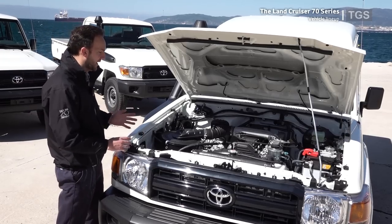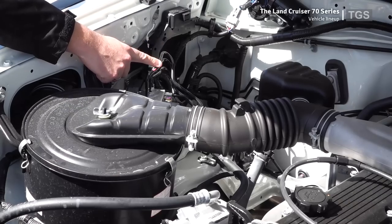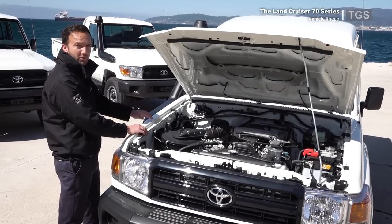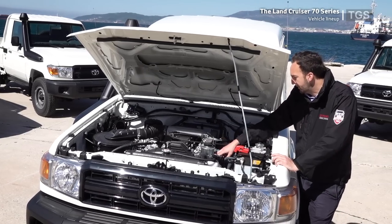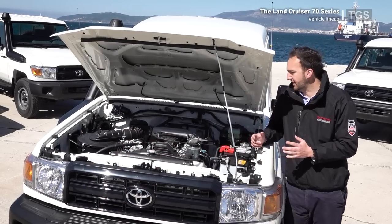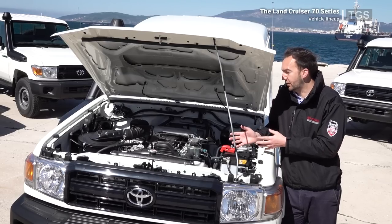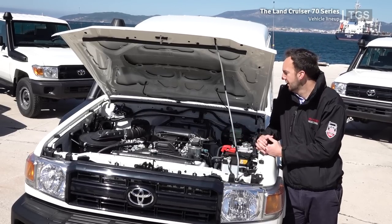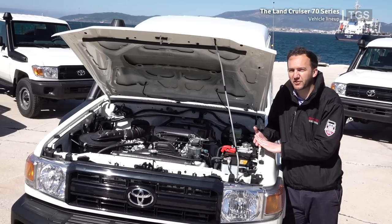Looking under the bonnet, our vehicles are fitted with ABS — we can see the ABS pump fitted on the right. We also have a cyclone air filter fitted to the snorkel. On the left side of the engine, our vehicles are fitted with a high altitude compensator bolted directly to the injection pump. When operating in high altitude, the air is thinner with less oxygen, so the compensator reduces the amount of fuel injected, resulting in less unburnt fuel, less black smoke, and better efficiency overall.